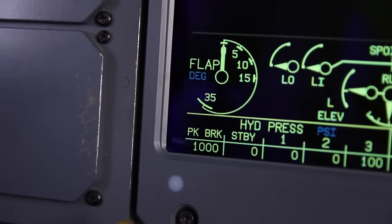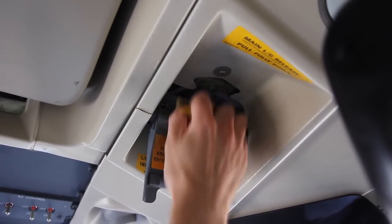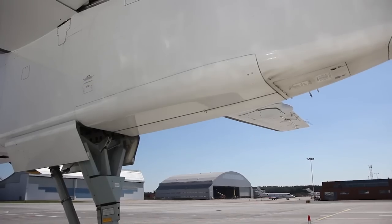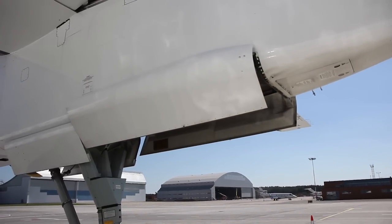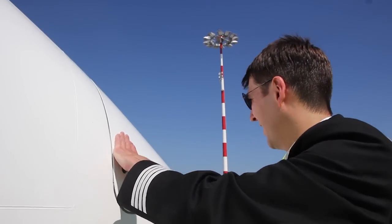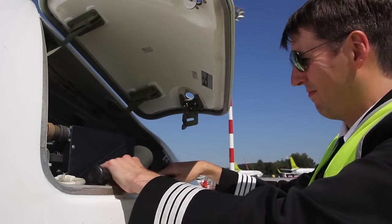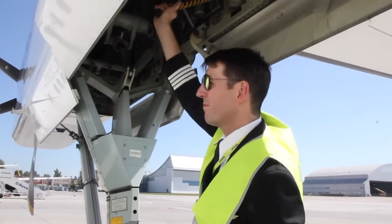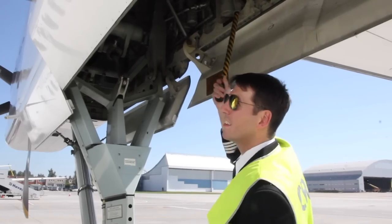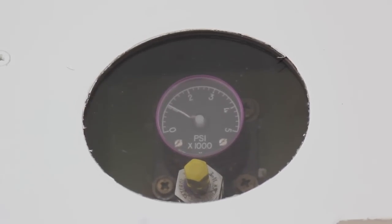To pump up the pressure, first we need to drop the main gear doors — go back to the flight deck, open the landing gear alternate release door, pull fully down on the handle, then close the door again. Ensure the handle inside is properly seated and the door is properly closed, or the undercarriage will not retract. After opening the gear doors, get the pump handle from the upper right nose bay, find the hand pump in the gear bay, and start pumping. Normally around 5 to 10 pumps will do it. When you have at least 500 psi you can stop and stow the pump handle. Switch to composite display in the flight deck to confirm the actual pressure.